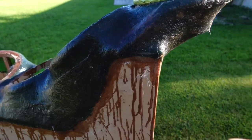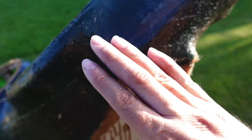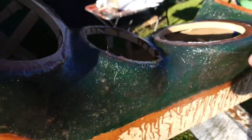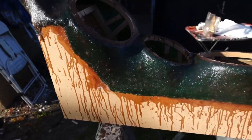But for the most of it, like you see, our seams are already gone. So what we do here is we lightly grind it, and then we fill it in with our badass Duraglass, and it'll be like it never even happened. Same thing over here. But probably when we do our next layer, I'll put another strong layer of fiberglass mat on it, so the structure of it's good, so it's not all just filler.